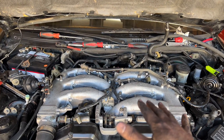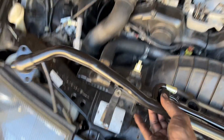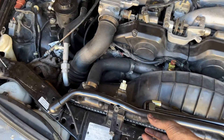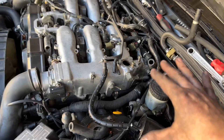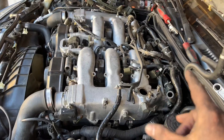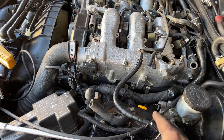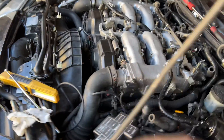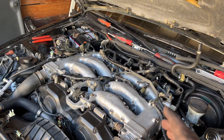All right, I think I'm getting there. I've got all of the bolts started. I did hit this with black paint and I'm glad I did because it looks pretty cool back there. Now it's time to torque this thing down. I've got PCV tubes on both sides, the EGR tubes lined up, and I think all of the wiring is run. I really don't want to squish this gasket and then end up having to take this thing back off - I feel pretty confident.